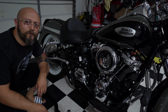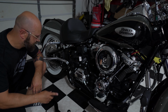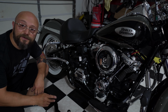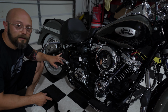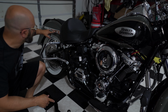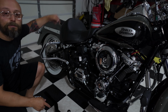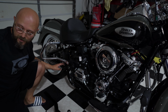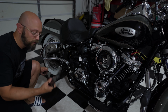The exhaust is off. Let's get the brackets installed on both sides. It's gonna be a little interesting. I gotta figure this thing out, and the manual doesn't say anything about it, but obviously I removed the bags, and as you know, on the Heritage bags, there are two mounts here, and then there's a bushing here where a supporting arm kind of fits in. So I had to remove the stock bracket, and in its place the new bracket will go in.